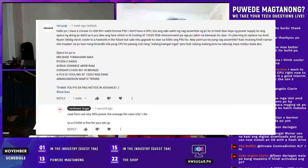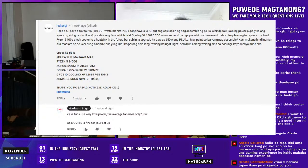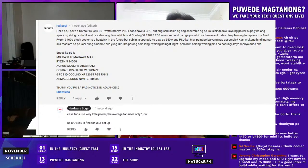Next question from Red Poggy. Actually, it's a very detailed question, and in fairness to him, we do encourage you to be as detailed as possible when you ask, because it's hard to diagnose with incomplete information. Basically, it's a whole rig, and his power supply is a Corsair CV450, just a step above the VS series. But when he had it assembled at a shop, they were going to put 6 fans for air cooling. The shop said that because 6 fans consume so much power, he needs to upgrade the 450 watt PSU to a 650 watt. He's asking, is that true? Does the assembler have a point? Because they don't seem very knowledgeable about PCs, and he wasn't satisfied with the way they were assembling it. From 450 watts to 650 watts, just because of 6 fans.